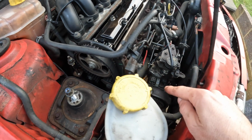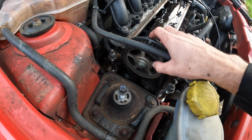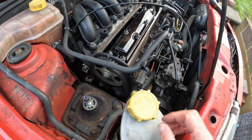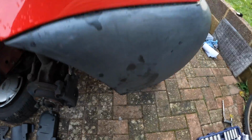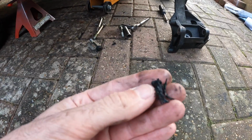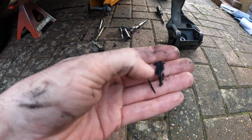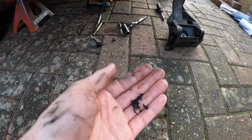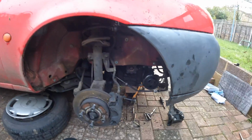But where the fuel pump has been leaking, it's caused some contaminants in it, and when the belt has started breaking apart slightly, all the dust has accumulated with the fuel mixed together. It caused some sludge. I think there's still some under the van. If you see down here, this has accumulated in the camshaft covers, and as the belt has deteriorated, the fuel stuck to it and caused it to gather up, but we're changing it all, so it's all good.